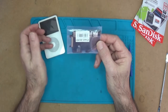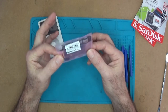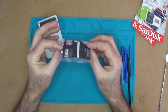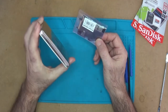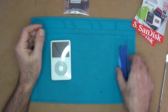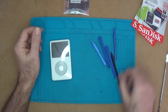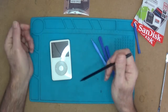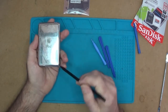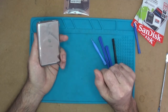It should be almost a straight replacement for the actual hard drive, but we need to get this open, get the hard drive out, and have a look at what we can do. I've never done anything like this before — I've never split one of these down. I looked on YouTube and found a few videos on it, so hopefully it should all go well. I'm going to need these prying tools to separate the case, and I've got a spudger to release the battery cable at the bottom.